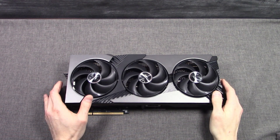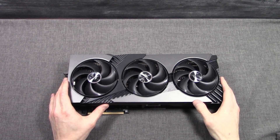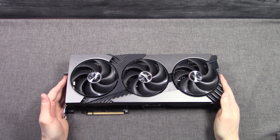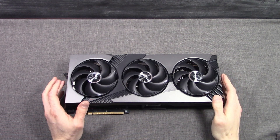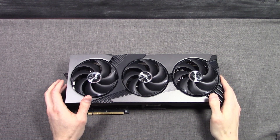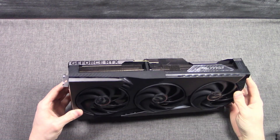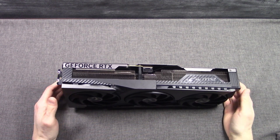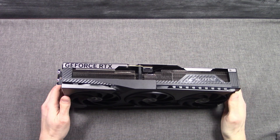In terms of size, this thing is pretty big — do not underestimate the size. The size of this video card is 357 millimeters long, 151 millimeters wide, and 66 millimeters deep. This is a three-slot video card. Being pretty much 14 inches long makes it two inches longer than the Founders Edition RTX 5080. This also weighs 4.2 pounds, so it is not a light video card. It is big and not light, but it is not the biggest we've ever seen at all — it is a workable size. Just make sure you have enough space in your case and cooling as well.